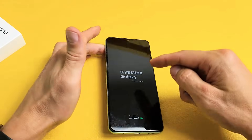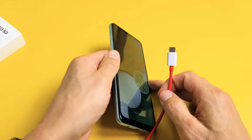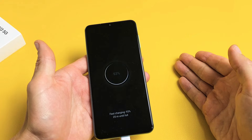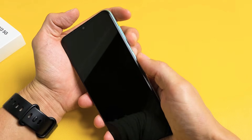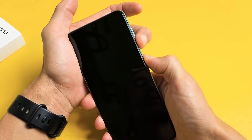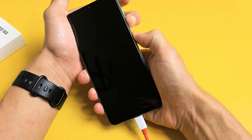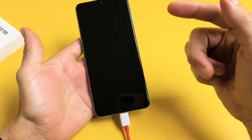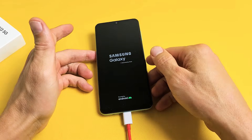If you're still stuck in a boot loop, no problem. Grab your charging cable and plug it in. Count to five seconds, and then while it's plugged in and charging, we're going to do the same thing — force restart it. Volume down, power button. Press and hold both buttons. Continue to hold until we see the Samsung logo, then let go of both buttons. Wait for it to boot up normally, and hopefully you are now out of the boot loop.